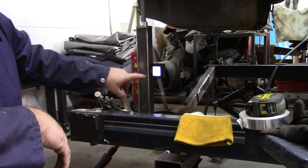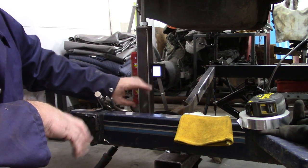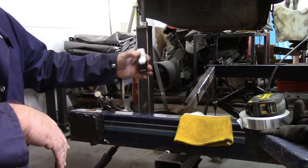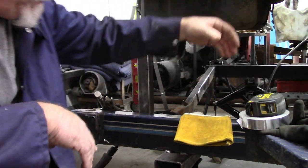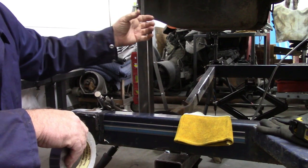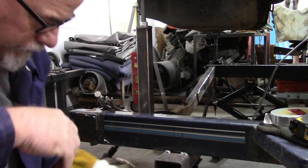Here's what I've done: I used my digital level indicator — I'm at 89.97 degrees, which I think is pretty close. Coming over to this side I'm at 89.7 degrees, so that's where I'm going to stick with what I have. I also took some foil tape and wrapped it around the top of the thread up here to help center it in the hole. I'm pretty happy with all of that and I think I'm ready to put some welds on it.